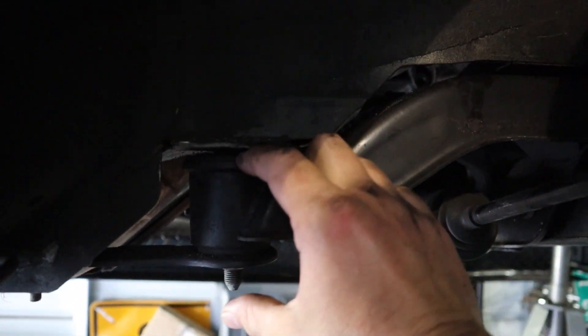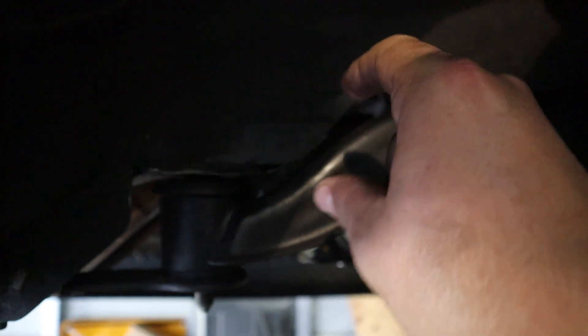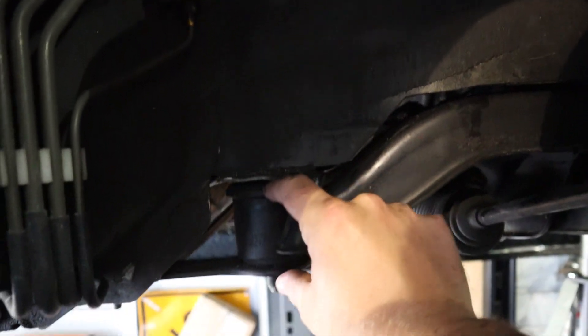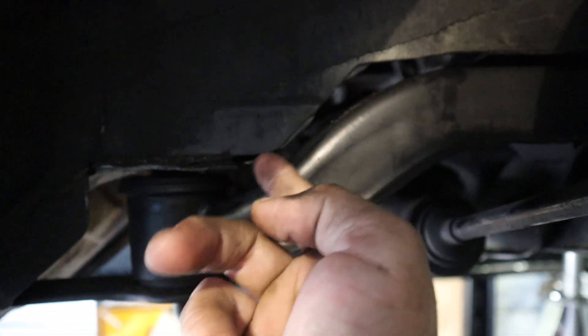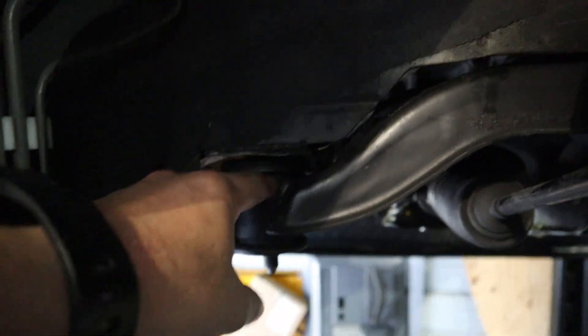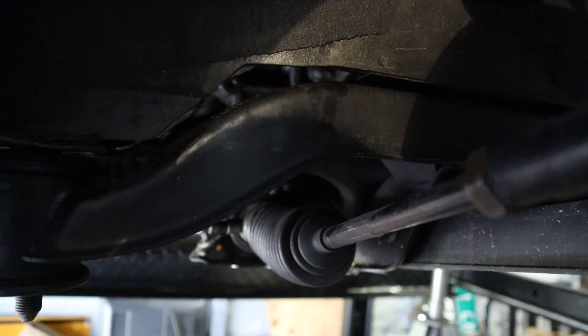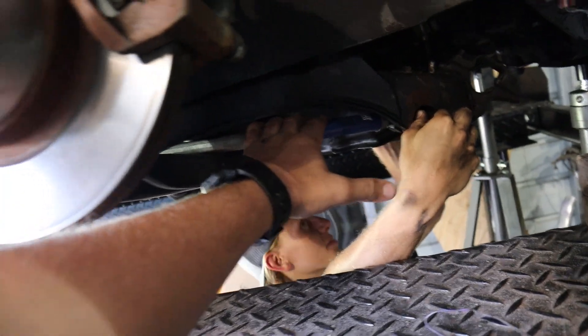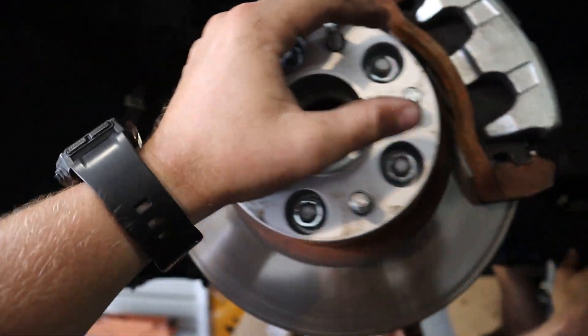Update time. Being that this is a four-post lift, we used these smart little jack stands on the front of the car - basically lowered it onto those so the front could come up. We're checking out what we're going to do. This back mount is obviously lower than the front one - it comes up all the way across and then bolts up right here. However much we take off the top, we have to make sure we take off the bottom so everything can go up. This little lip might be a bit of an issue, but we can either notch some of the subframe or cut that lip off.